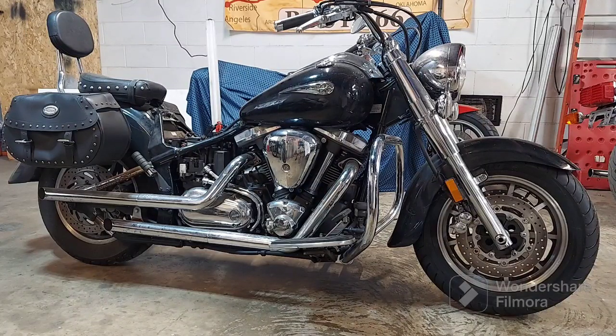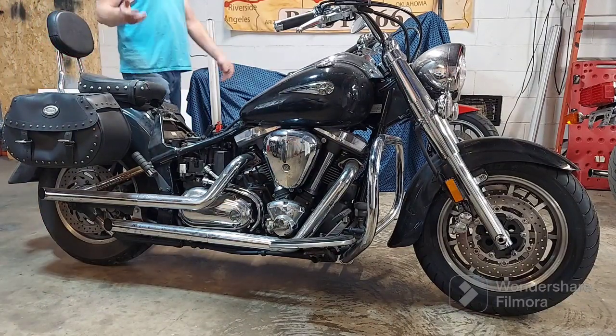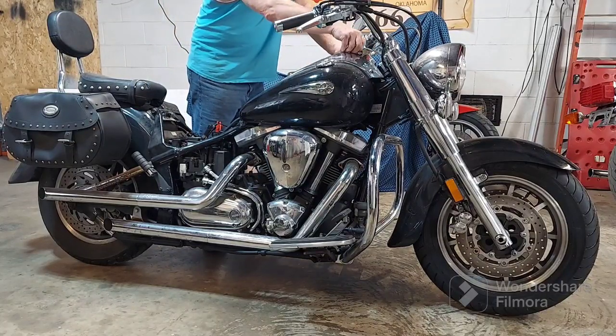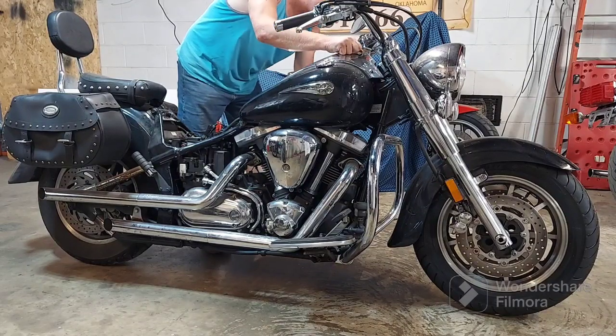And also I think that battery is shot. It charges up, but it doesn't hold the power very long, so it's on its way out, I do believe. But let's try to crank it again, see what happens. We might have to dig into it further. Also remember, it just sat 10 months with bad gas in it, until I guess it all dripped out over there on that petcock. Both screws are leaking and the gasket between the tank and the petcock is also leaking. So he probably didn't run out of gas. I think it just leaked out while it sat there. So much for my idea. Let's see if it does anything.